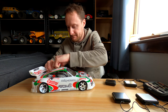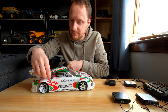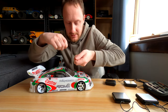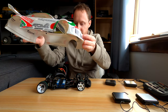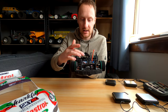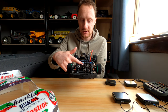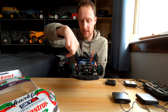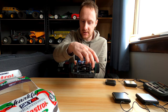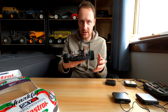Let's have a look underneath. I have tidied the wiring, so the car's essentially done. It's all well and good trying to get nice small body clips that don't ruin the look, but they are a pain to get on and off. I've tidied the wiring, I've stuck down the receiver. I've put the receiver slightly offset — the servo's slightly that way naturally to get the servo horn down the centre. The car's slightly lighter on the front left than on the front right, so I've put this receiver slightly in towards the centre. I'm trying to get the weight distribution as well as possible.